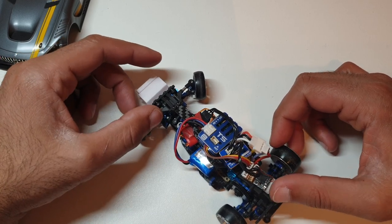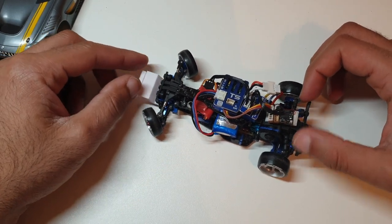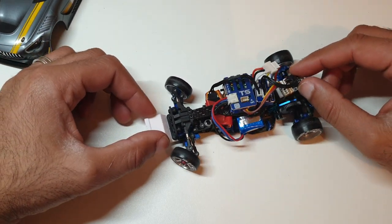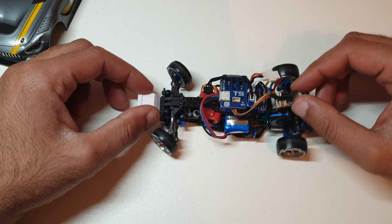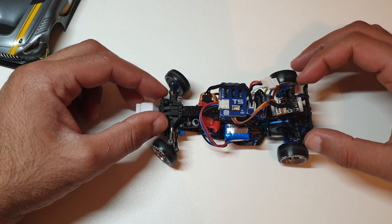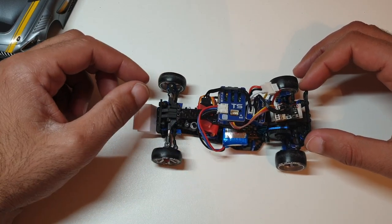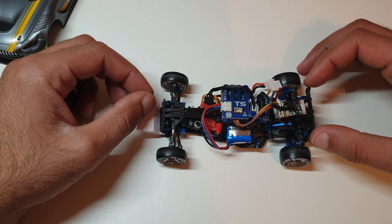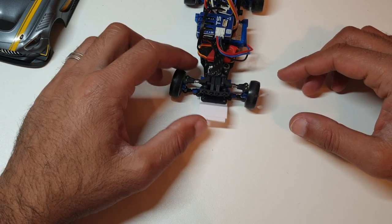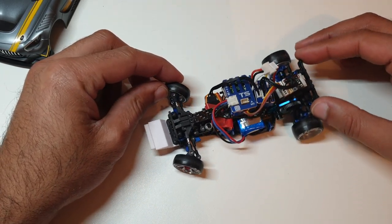On a rear wheel drive car like this, as you start to counter-steer, if you keep the throttle at the same level the car will carry on drifting in that direction. If you want to change the angle of the car, you then have to decide if you're going to exert more power — which will cause you to spin out — or if you're going to play with your steering. This all depends on what point the car is in the drift. If it's at a point where it's got plenty of balance and it's not going to over-spin, then you can give it a bit more power and the angle will increase.